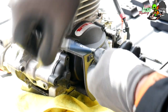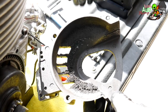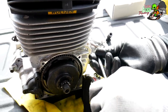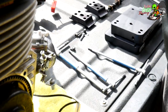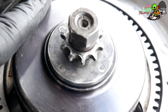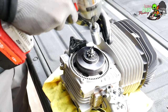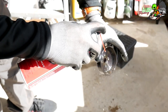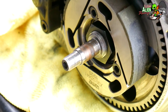Doug is removing the clutch cover — it's held on with three bolts. When he takes it off you can see how dirty it is from the chain lube. We're gonna have to clean that out. He's removing the ground wire and disconnecting other wires to get it free so we can clean it. I'm inspecting the front sprocket and you can see how it's kind of rounded — I had my chain pop off and I'm gonna have to replace that in the future. He's wiping the clutch off with a dry towel, then applying brake cleaner and wiping it dry.